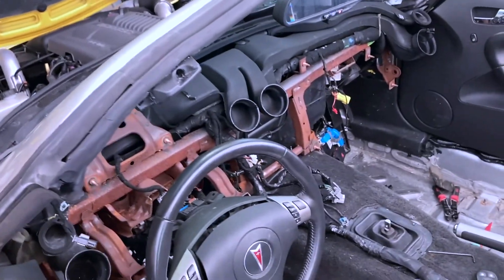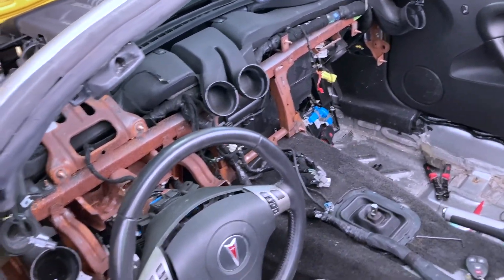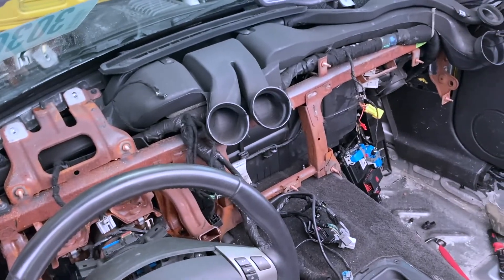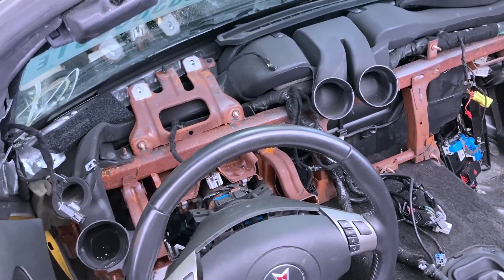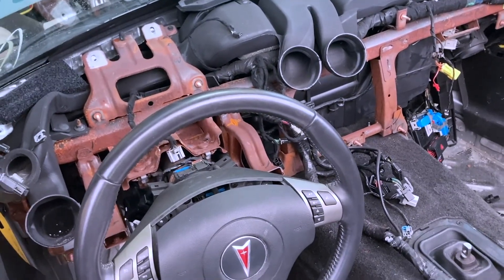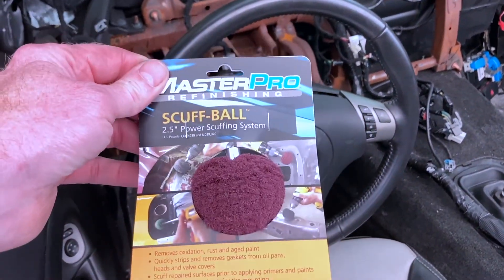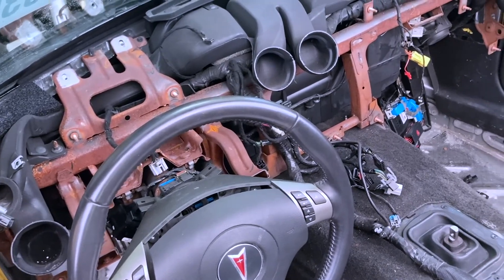Anyway, you can stay over to this side — it's not too bad. So the first thing I'm going to do on this interior to get ready to start putting it all back together is get a lot of that rust off. It's just surface rust but I don't like it. I'm not going to paint it because a lot is left non-painted because of grounds and stuff. I've got this scuff ball — I'm going to go around with the drill and try to get the biggest flakes off.